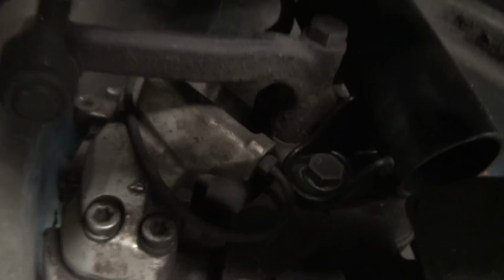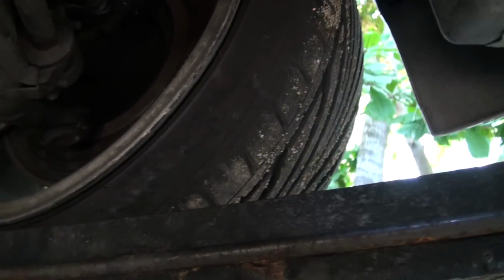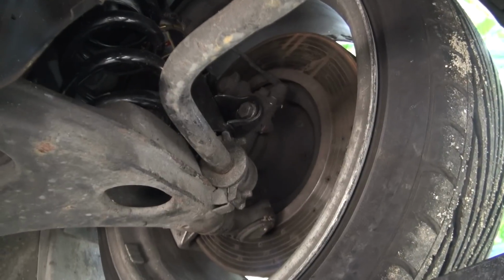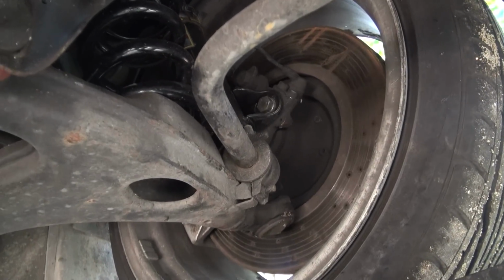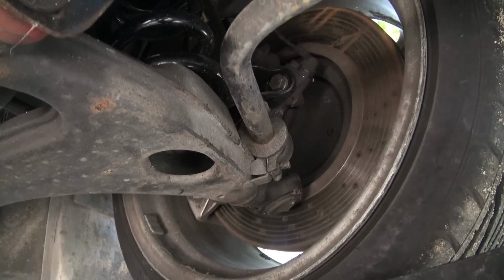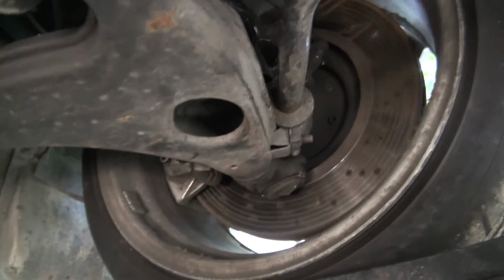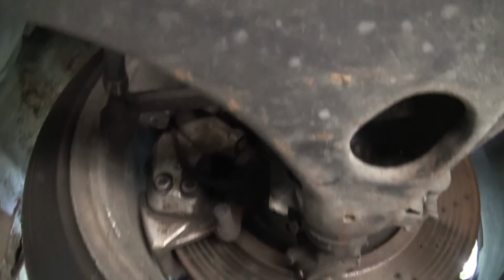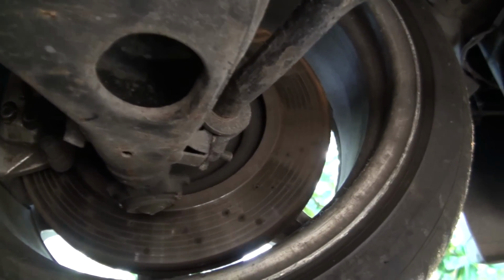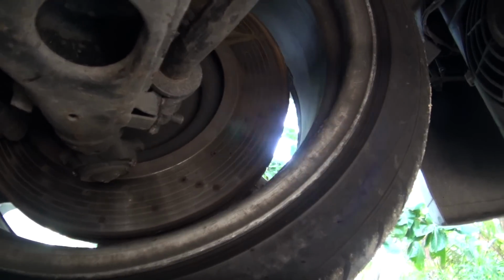You can see how the line comes in from the bottom, and that is because on a Mercedes C32 the calipers are mounted ahead of the spindle, but on a 190E they're mounted behind, so you had to take the set of calipers, disassemble them, and mix parts and then put it back together, and then that's what you get so that you can fit it in there. It's a tight fit. Underneath these Evo 2 wheels, the 17-inch, 8¼ wide rims that he's fitted on here.